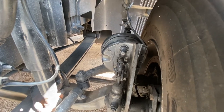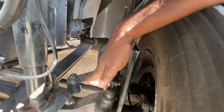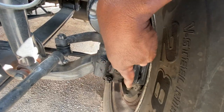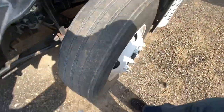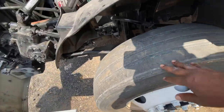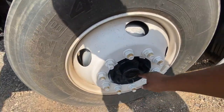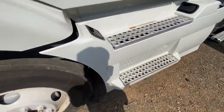After you check the steering, look at your braking system. Check your brake hoses, brake chambers, push rod, slack adjusters. Then check those brake shoes — make sure your brake shoes are not less than a quarter of an inch. Check the condition of your brake drums, check the tires, outside of your tires, rims, and hubs. Check the sight glass of your hubs and make sure your lug nuts are not loose.